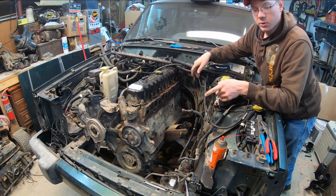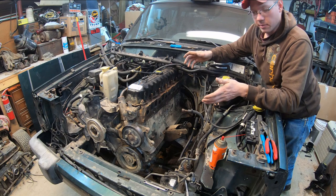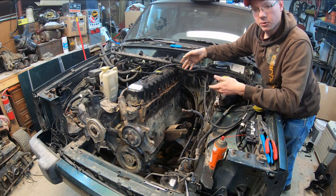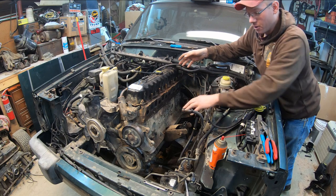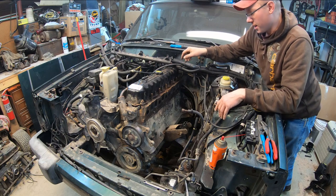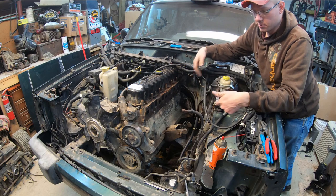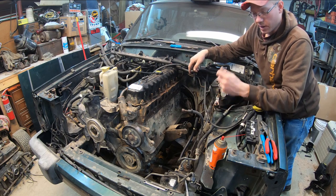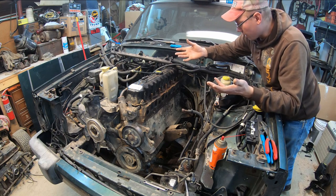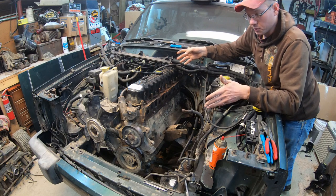And then I went to rotate the motor to line up the torque converter bolts. And the engine wouldn't spin. It was locked up against the transmission somehow. So I had to loosen all the bolts back up in the transmission. And I already had it sitting up on the motor mount, so I had to drop it back down to get to the top two. And then as I was loosening it, the engine became free and spun. And when I was spinning it over, it felt like something just clicked and went together right, and I was able to crank the bolts back down on the transmission. It still spun over good, so I bolted up the torque converter.